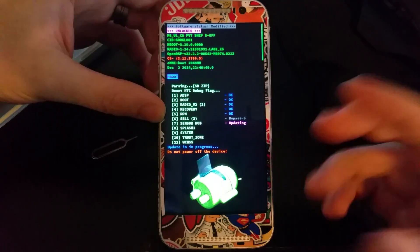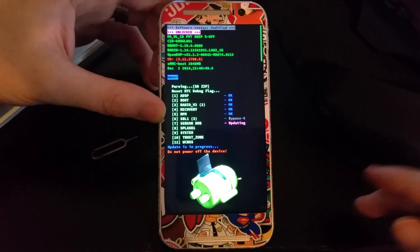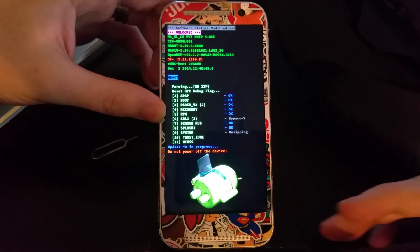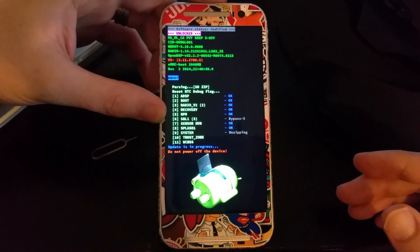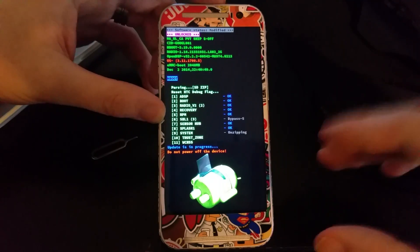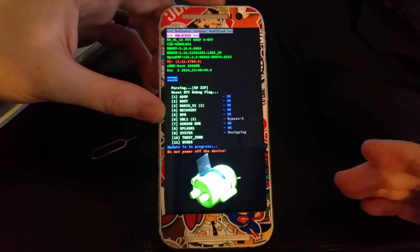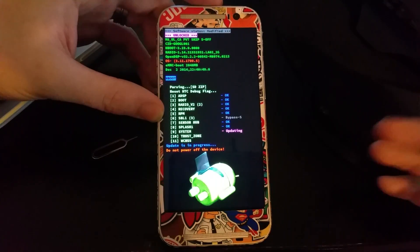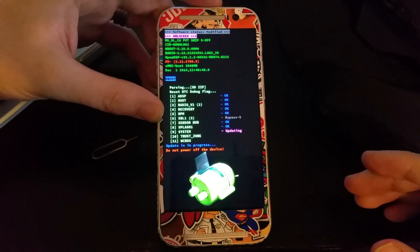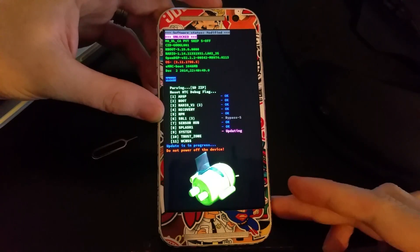While I had root access I'll explain what I did: I uninstalled BusyBox using the BusyBox app, I went to Xposed Framework and uninstalled it, and I uninstalled all the apps that Xposed Framework needed — because you can't use Xposed Framework with 5.0 at the moment. I tried everything including a full unroot. I powered the phone down and back on with no SuperSU app, no root access.